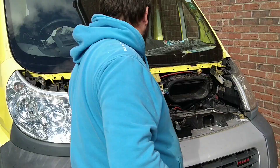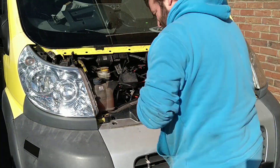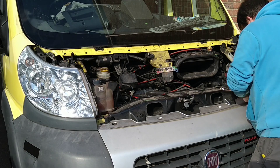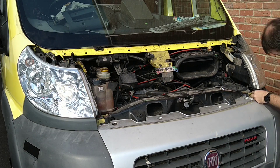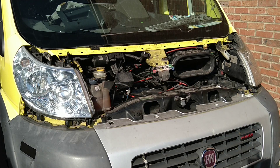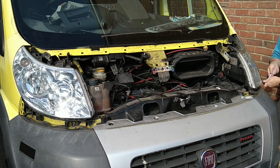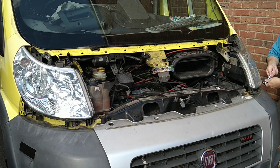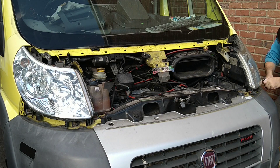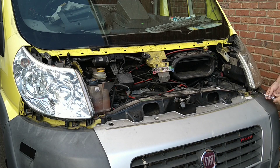What we found out is that a lot of wires are coming in from behind the passenger side headlight. So the next stage is taking off the passenger side headlight. There's a screw that holds in the little plastic caps that have just been taken off, and then there are two bolts at the bottom and one bolt at the top that hold it in place. It also clips in at the top, and then there's a wiring loom that connects into the back.